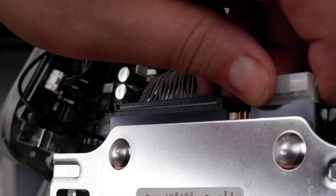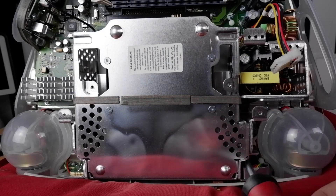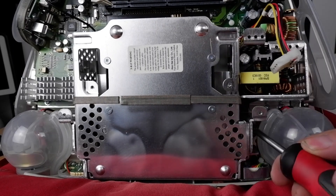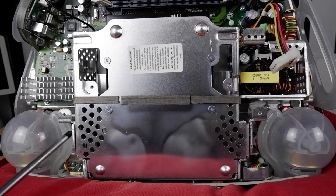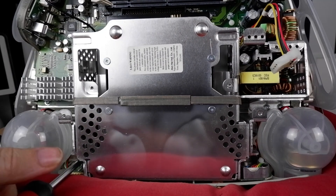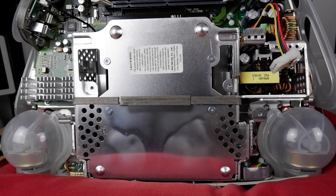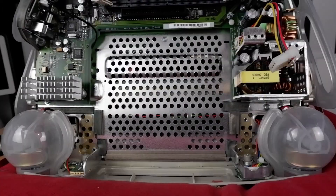Turning to our drive caddy, we have to unplug both the hard drive and the CD-ROM drive, and that's easier said than done. I'm going to speed this up a little bit because there's a lot of jiggling to get these things out. Now that it's disconnected, we can take the drive caddy out as a whole. This is held in by just four screws, and again they're Phillips screws, making this a nice easy job to do. With the screws out, the drive just lifts towards you and you're good.